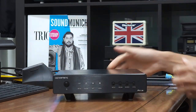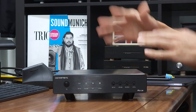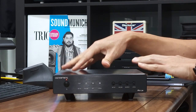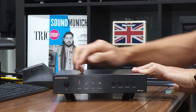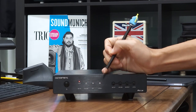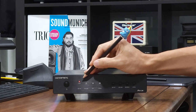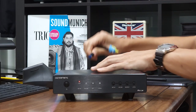First, I'll need to power up the unit. As soon as the streamer receives power, the standby LED turns on. Hit the power button once — the startup sequence will begin and the LED flashes from left to right. It takes about three to five seconds for the unit to fully start up, and the last selected input will turn on. If you have the network cable connected to the unit, the net LED will turn on after a while.